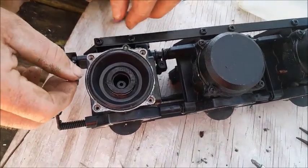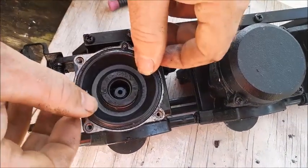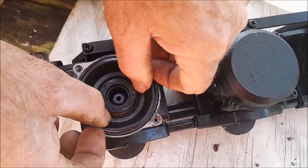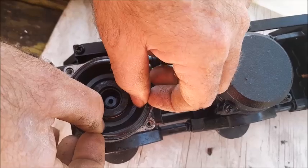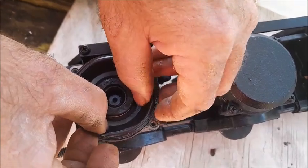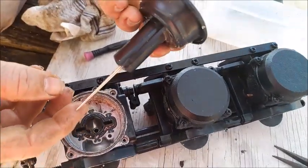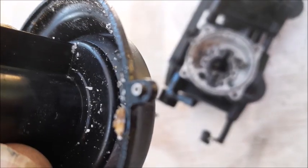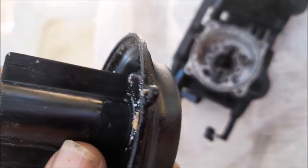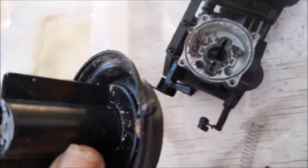Now there's this diaphragm. You'll notice that there's a little small metal piece right here on the tab. Be careful not to tear this because these do have to be removed to get down to some of the other parts you need to clean. This just lifts right out of there. It has a metering valve on it. There's also that little small piece of metal stuck in the side of that diaphragm rubber — make sure you don't lose that piece.